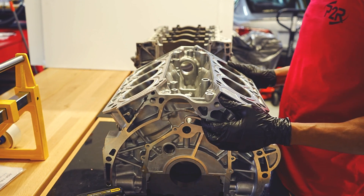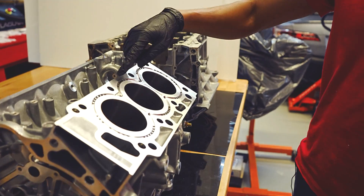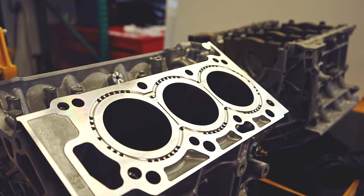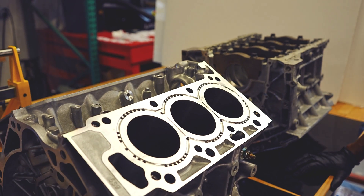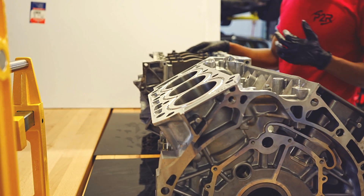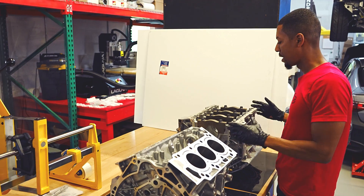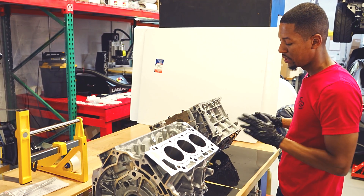This block was sent over to CSS — you can see their logo right here. They went ahead and machined the sleeve support in this block. According to CSS, he believes this block is rated for about a thousand horsepower. We already made pistons and rods for it, so once we put this motor together we pretty much have a block that's ready to go for a thousand horsepower. I actually have a pair of the brand new cams here but haven't checked how much lift is in those factory cams yet — that's something we'll have to check out soon, but the block itself looks great and is ready to go.